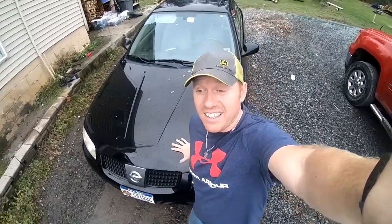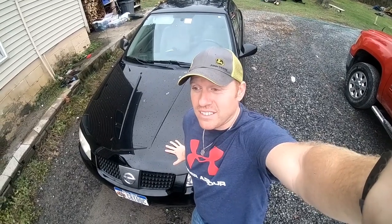Okay, so last night I finished up and was finally able to get that valve body back in. And man, I tell you, that is a pain in the butt. If anyone is going to change the transmission filter on any of these Nissans, just be warned about the way they made it: you get all your bolts back in except for one. That one bolt only has a little bit of threading at the end, and it's a long bolt that goes up in, and then there's a nut that sits on top of the valve body. When you take it out, the nut just goes off to the side, and there's no way of getting it back in there other than dropping the valve body like I did last night, which was horrendous, especially laying on the ground.